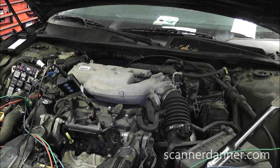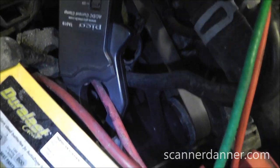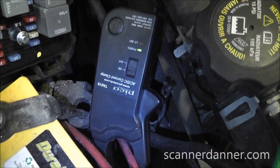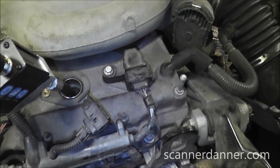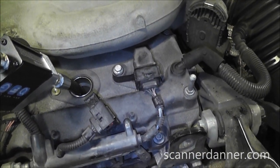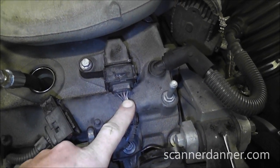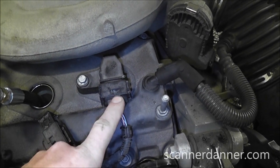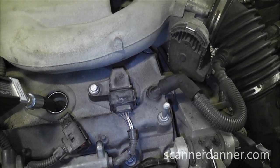Then we started doing our scope test on cam, crank, and relative compression. Our next thought was to synchronize our relative compression with an ignition firing event. I'm using the Pico high amp probe connected to the main cable that goes to the starter to read starter current, and I'm going to synchronize this with one of our coils up front — the back coils are a little more difficult to get to. I'm picking one of the control wires — the small base circuit square wave turn-on signal — to synchronize with starter current and give us an idea not only of compression, but also where the ignition is taking place in relation to top dead center.